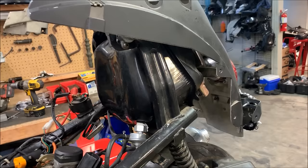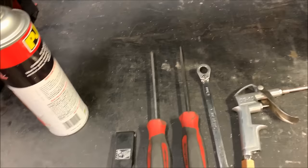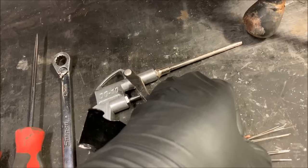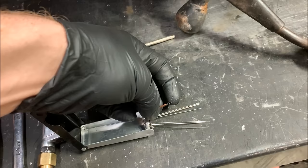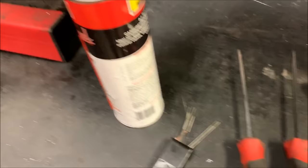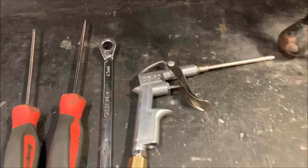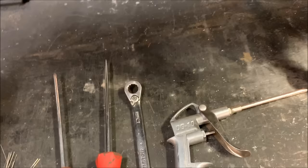You're going to want a few tools — no special tool required per se, but it definitely makes your job easier. Basic tools are a flat-head screwdriver, number two Phillips screwdriver, number 12 wrench if you're working on a four-stroke scooter to take the throttle cable off. We have Helix-branded jet poke tools here; most jet poke tools come with the correct sizes for smaller carburetors. The important one is a wire small enough to run through the pilot jet, since that's the main thing that gets clogged. You'll also want carburetor cleaner — we sell PJ1 carb cleaner on the website, not California legal, so that means it works really good — and an air blowing nozzle, this is a Harbor Freight special DG-10 power blower.